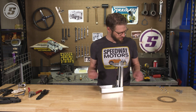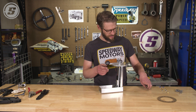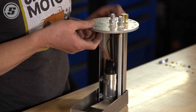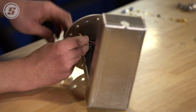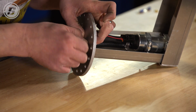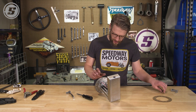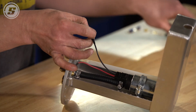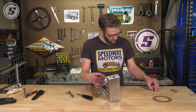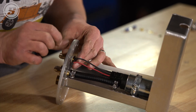It's important that you insulate this plate from the current. These nylon washers and O-rings act as the insulation, so make sure that these are installed as they should be — otherwise you're going to have bigger problems. We'll spin the nut on here to hold everything until we get our truck-side wiring attached. For the negative, we put our screw through, followed by the washer, the brass washer, then the nylon piece that goes in the hole — make sure it's turned so the step goes inside the hole. That does it on the internal side.